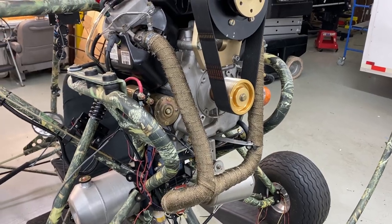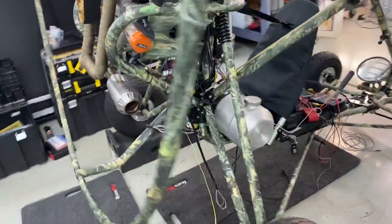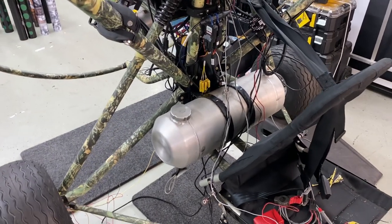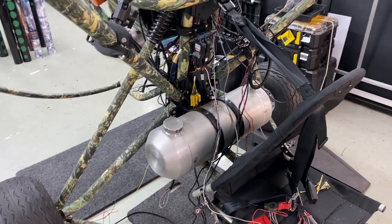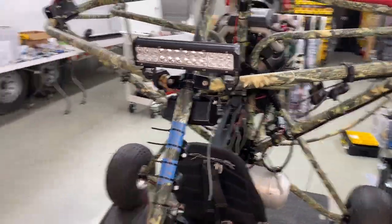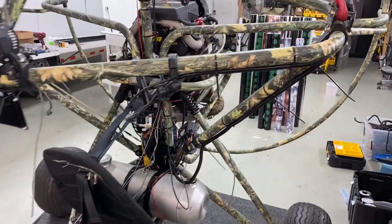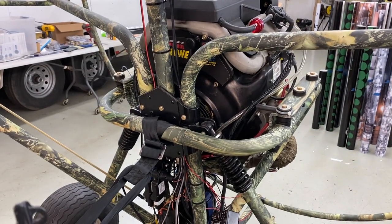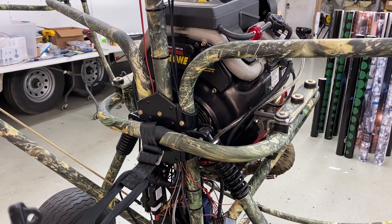Same thing on the other side — CHT and EGT. There's also a custom header exhaust job which doesn't look too shabby. The machine holds five gallons of gasoline, which I think is fine and keeps it legal. I understand that's about four hours of flying and I've never flown that long. A headlight has been added and works pretty well, though I'm still uncertain about the charging system on this engine — I haven't identified any charging system components, so if anyone knows, I'd love to hear it.